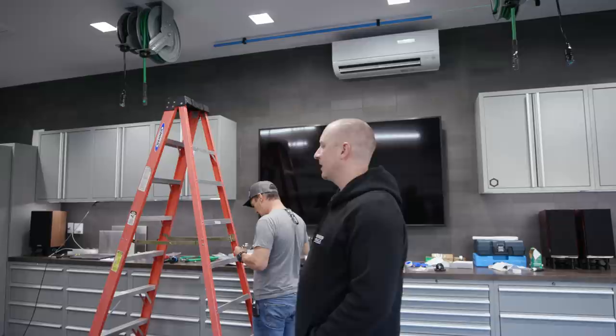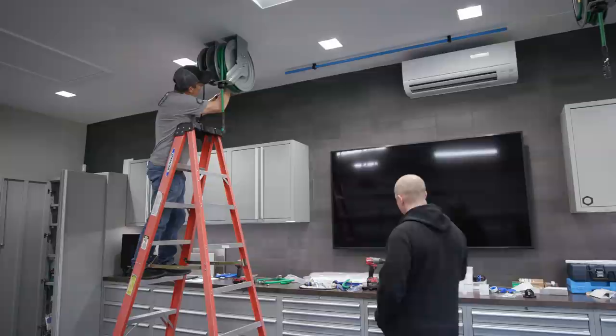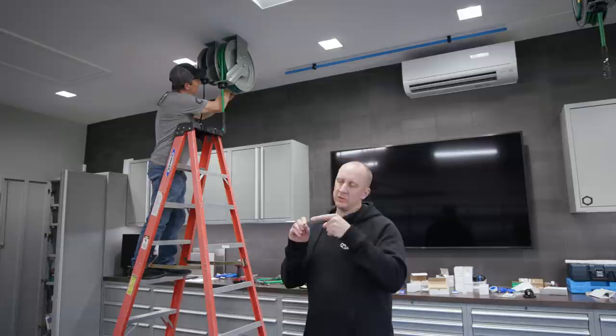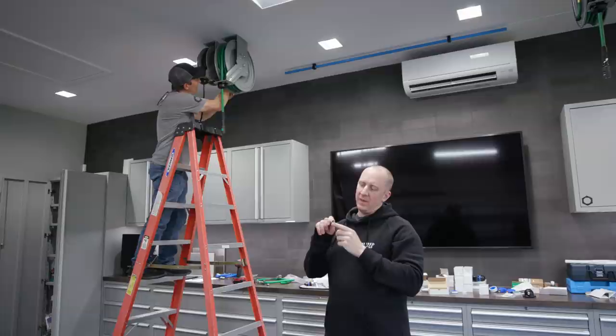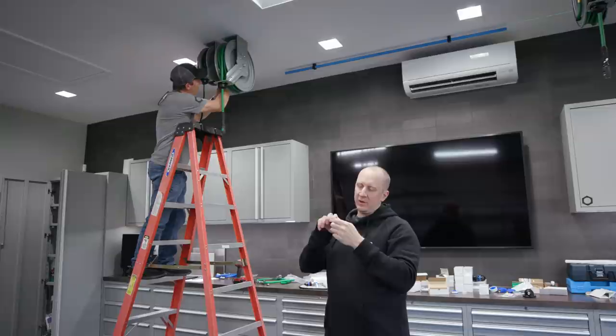So we have a stainless pressure washer, high pressure 90, and put that on the air hose reel so that it turns the air line so we can come straight in instead of looping it out. Barb fitting, from these guys into the 90. The hose reel has a female inlet, and we put a male to female 90 street elbow. Yep. And then take this NPT 3/8 barb fitting, screw that in there, and then this hose.